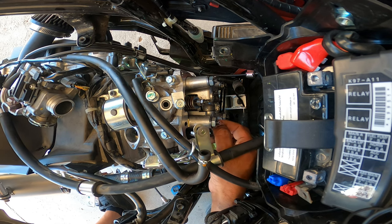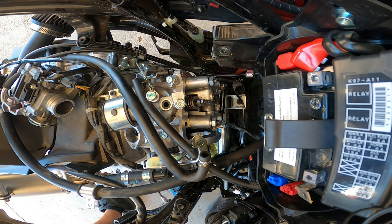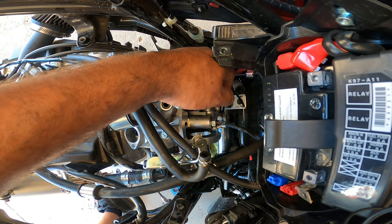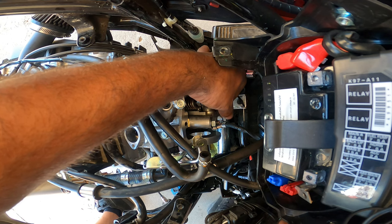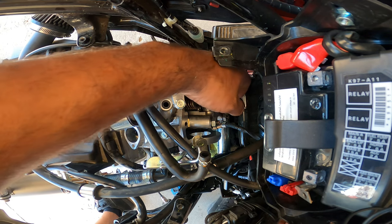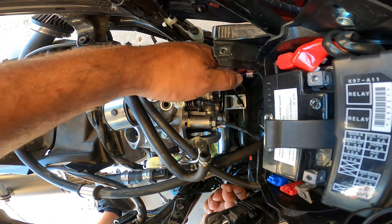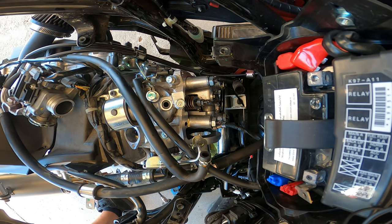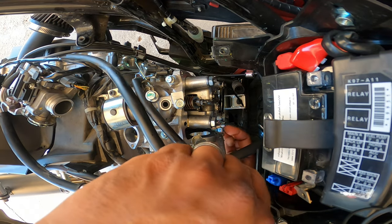So this right here prevents the cam from coming out. These two 8 millimeter bolts here, I have no idea what they do. Honestly, I'm not gonna lie, but as per Scooter Swap Shop's DIY, they suggested removing them, so I did. So we gotta remember, we gotta tension these two. We still have the chain out, we gotta tighten that down. So this one has to be pre-tightened before anything else gets tightened on these guys, so this has to go on pretty snug. I don't have a torque spec for these yet. I'll probably list it in the description for you guys once I get the right information for it.